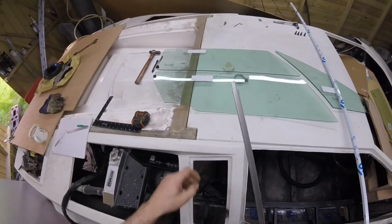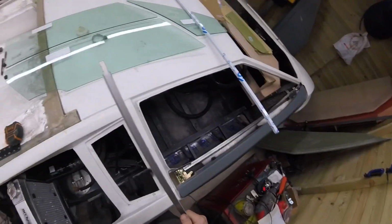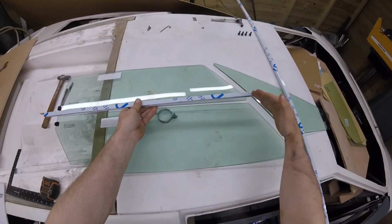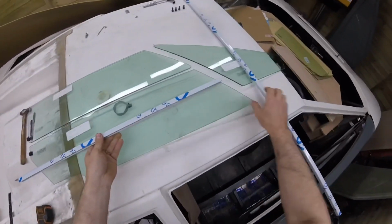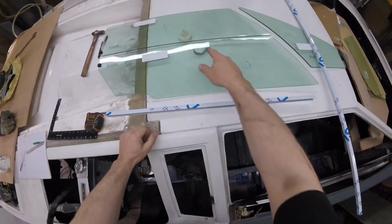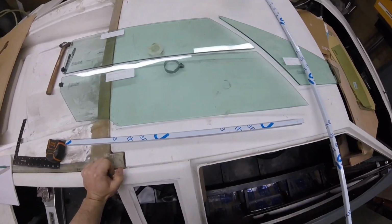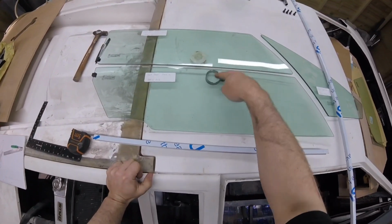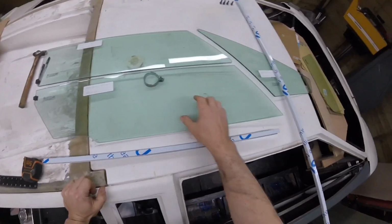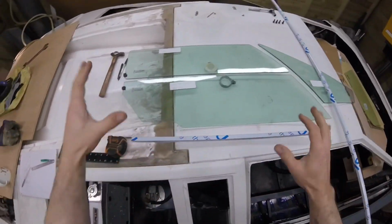That's what I'm going to do now. I'm going to measure, drill, tap a hole, and then we can see about what angle this is going to be cut at. It's going to be cut at the right angle. So you've got to think of a couple of different things at the same time. The glass has got a 15-degree bend in it. So I've measured both of those things I've got under there. If you can see them, they're both 15 mil high. So that's giving us our bend, so we can then work out all the rest of the measurements.